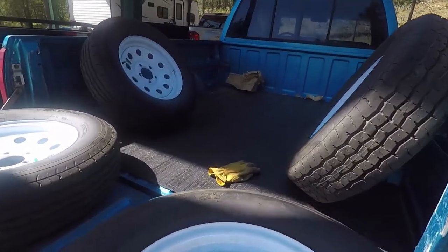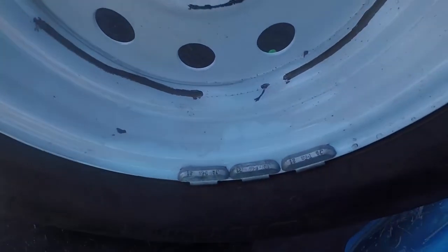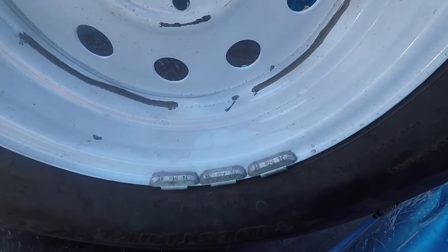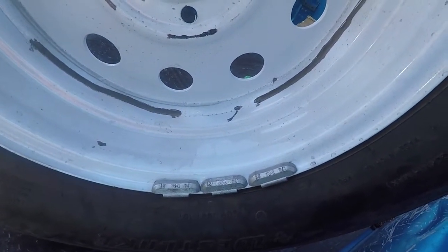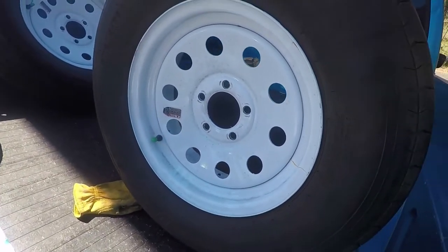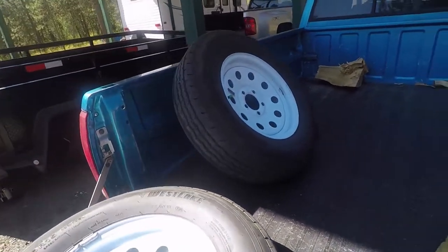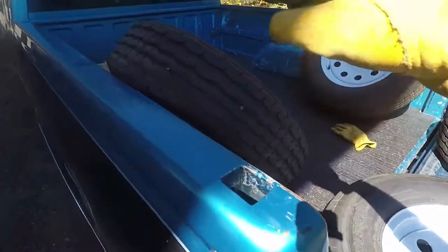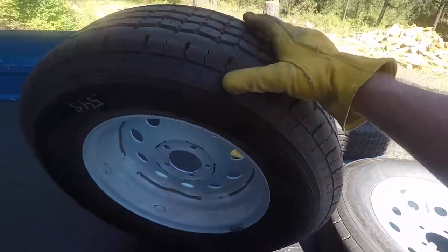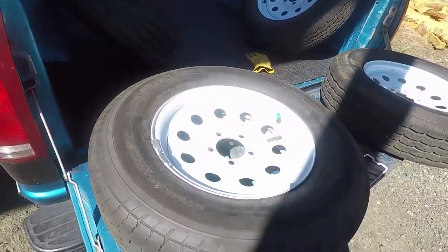I had decided to get these balanced because it was vibrating as well. Another tire here has three weights on the back side — looks like three weights that are three quarters of an ounce each — and no weights on the front. On the other tire there are no weights on the front, and there is also a weight on the back side — three quarters of an ounce. Once I get the tires mounted up I'll spin them and you'll see that one of these is out of round.